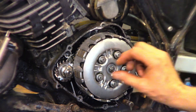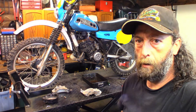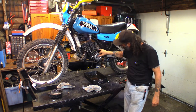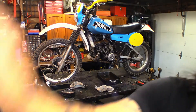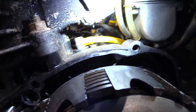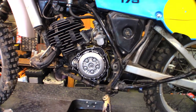The way you adjust the clutch is you have to adjust your free play. You loosen the cable up here, loosen your adjuster at your lever, and you adjust the cable length so the indicator on the clutch arm points at a little bump that's on the crankcase. The tip of the screwdriver there is pointing at the clutch arm, and it needs to point at this little tiny bump in the crankcase. It's lined up. That's what you preset your cable length to — it indicates on that section, and then you do your fine adjustment down here.